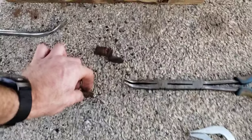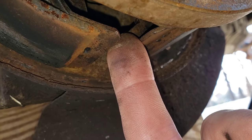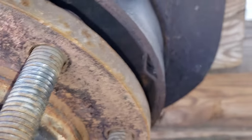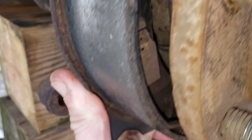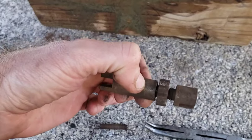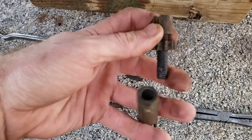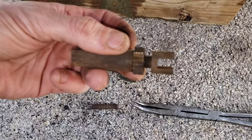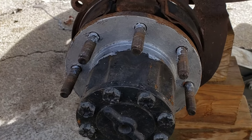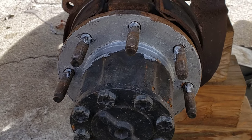First, remove the retaining spring located on the bottom side. Then take out one of the parking shoe retaining pins, just like you find on any typical drum brake. This gives a little bit of free play so you can pull the spring and stuff out. I removed one side — I chose the back, but it doesn't really matter which you choose. Then spread the shoes to remove the adjustment collar. I'm going to clean it up and put some anti-seize on the threads so when I go to adjust the parking brake, it's just a little easier. These things have a tendency to rust and become almost impossible to adjust, so anti-seize makes it a dream to adjust the shoes.